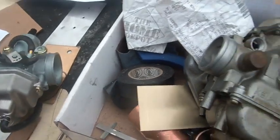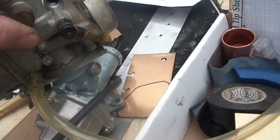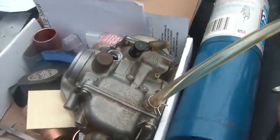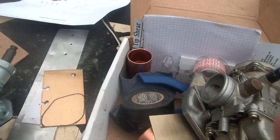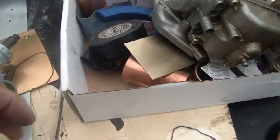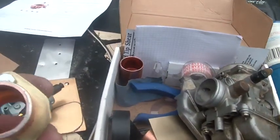I think if I really want to I can actually use the old air cleaner assembly, though the bore is bigger on this carb. Considering I don't have any plans on turning the Lakota into an OEM showpiece or selling it — it's a year 2000, so it's a 17-year-old rat — I'm just going to put one of those cartridge-style air cleaners on the end, pit bike style. Do check out a video someone posted shining a flashlight on the bottom of those cone filters — he showed air gaps where it wasn't glued together properly, which would allow you to suck stuff in.